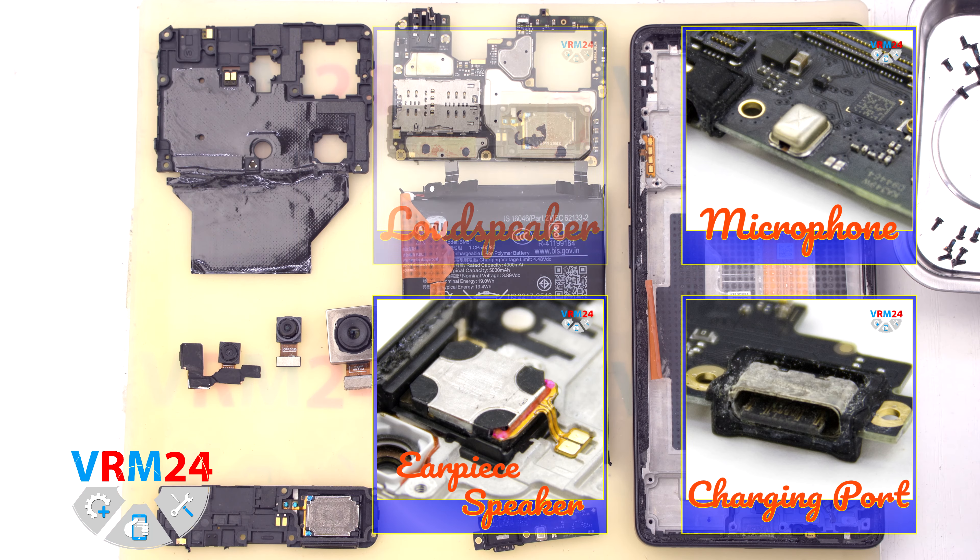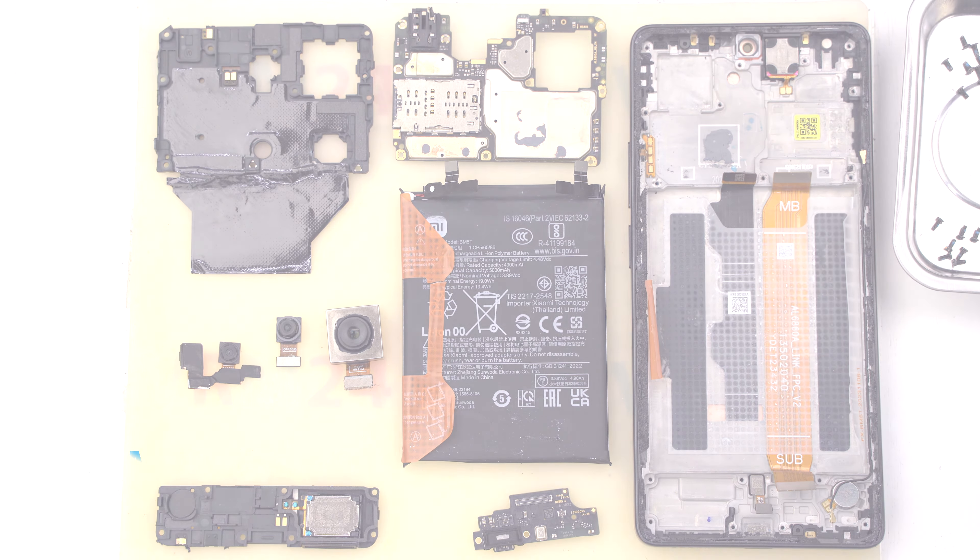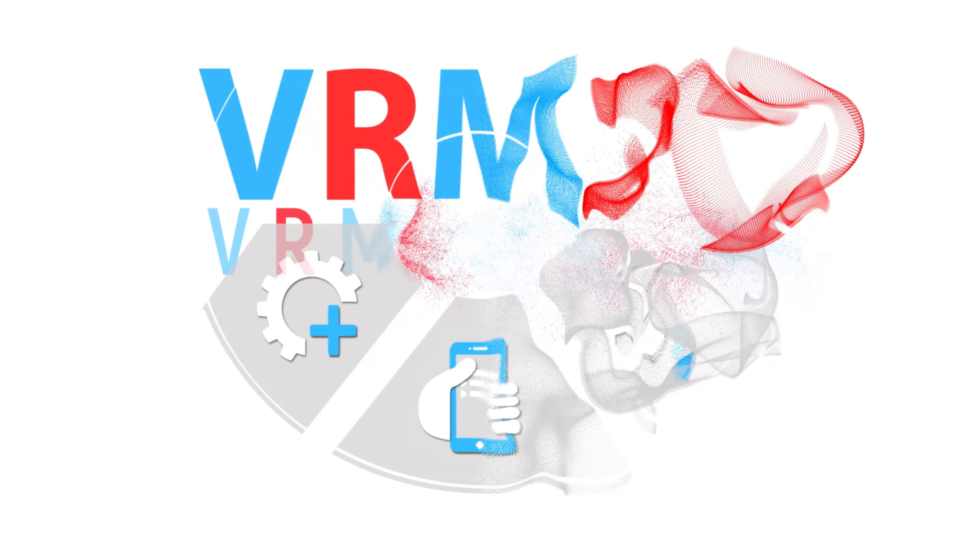In the display frame, we have the earpiece speaker at the top. Finally, we move on to detaching the battery. As we can see, the battery has been removed at least once before us. We need to unfold the brown tabs with the letters A and B, and read the description which shows the sequence of actions for removing the battery. We pull the white tab with letter A up, and the tab with letter B should be turned as much as possible so it doesn't interfere. We then detach the battery. Under the battery we have a transparent coating which protects the cables.